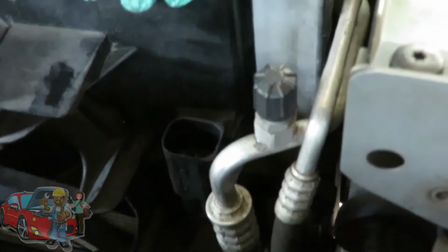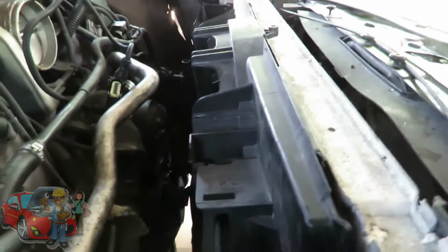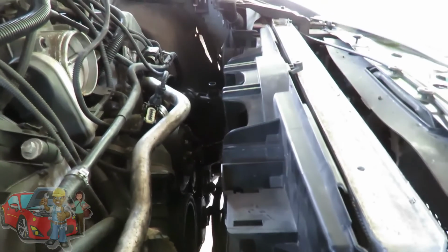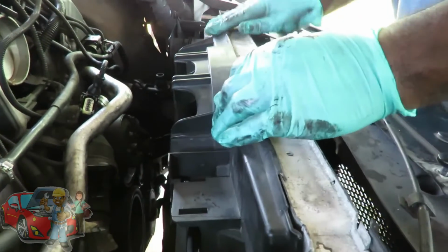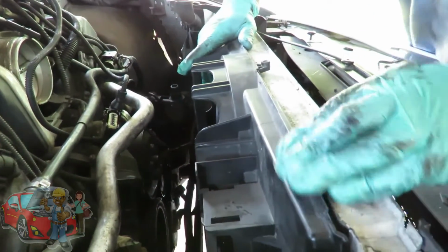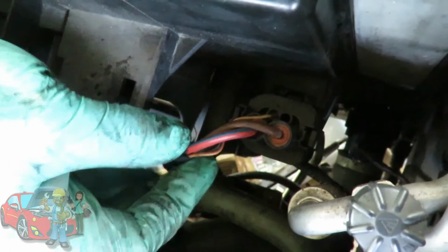If you look right here, down in there, you'll see the fan goes right down to the slot. And it's not going down, so what I'm going to do is go up under here and make sure that it is going into the slots up underneath. There. Huh? I think this part over here is wrong. Oh, dang it. Yeah, this was setting over like that. Now this one came up, so now I gotta go back over here. Okay. Perfect. Now, let's go over here, grab our fan connector, plug that in. Nothing. Huh? There it is. Okay. And that's that. Cool. All right, we'll be right back.